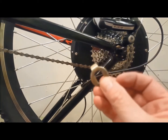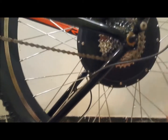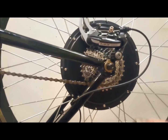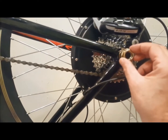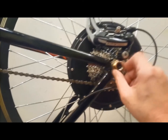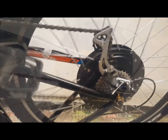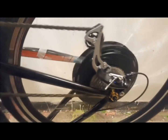It's very important that you have one washer on the inside — a normal washer on the inside of the frame — and the lock washer and the mounting nut on the outside of the frame. If you get that wrong, it will not work. Once I have firmly tightened the nut by hand, as tight as you can get it, I want to test that the wheel is spinning freely and true and that the movement of the chain on the cassette is aligned.